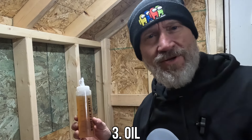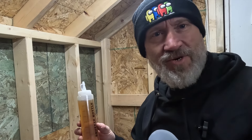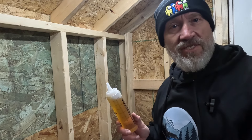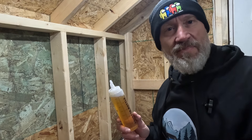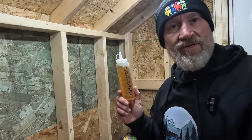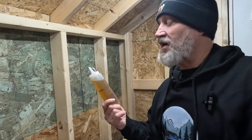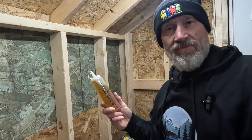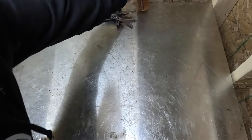Oil. Why would you take oil? You're not going to be doing an oil change out on the trail. But these bikes quite often will have a low oil cutoff, and if your oil gets low — maybe your filler cap isn't on tight enough and the oil is slowly leaking out — your engine may cut out, especially going up and down hills. So a little bit of oil goes a long, long way. About 8 fluid ounces, 250 milliliters. Throw some oil in your kit and forget about it.